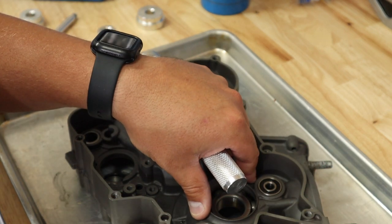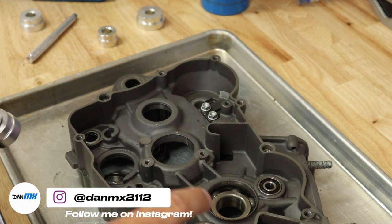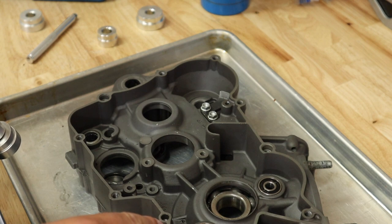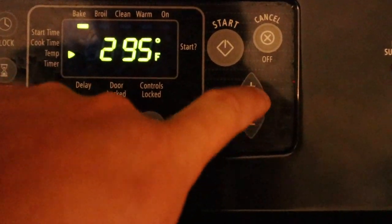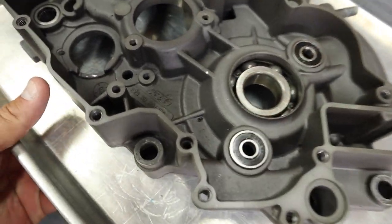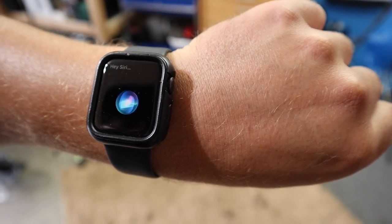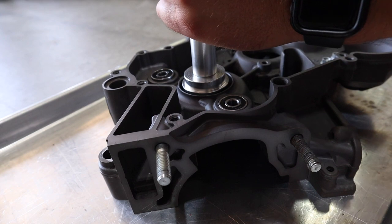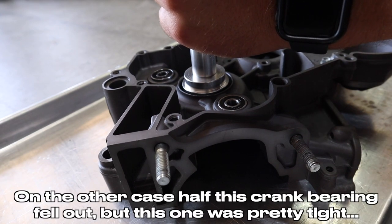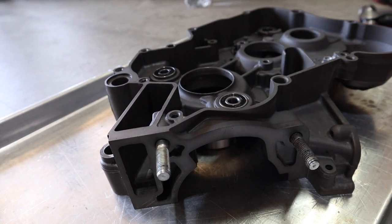Over here I'm not hot — I can obviously touch this. So this is not ready to remove the main bearing, neither of these. I'm going to save these for the oven and show you the blind bearing puller once I get the case hot. Set a timer for 10 minutes. Got my seal driver here — I'm just going to give it a couple of good taps and see if it pops right out. There it is, not too bad. Now while it's warm, I'm going to get my blind bearing puller and try to get these babies out right here.